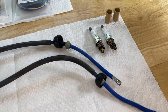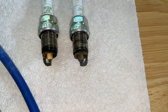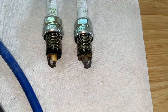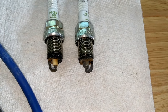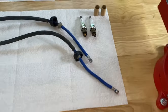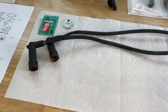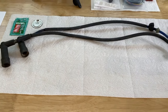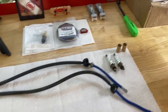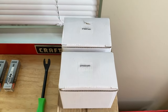Here are previously replaced spark plug wires, boots, and plugs. We had a little bit of rough engine running and a little bit of loss of power — and that's something that helped cause that. Look how burnt that spark plug is on the right-hand side. We are doing a lot to this jet ski — rebuilding or replacing many parts — and we'll post links down below. Here are our brand new ignition coils — we have two of them.